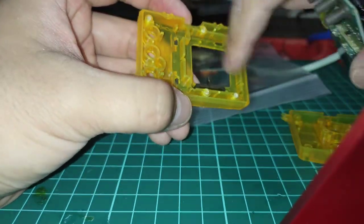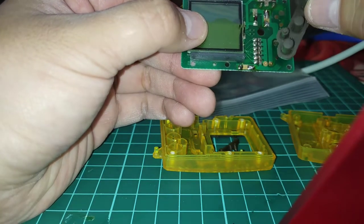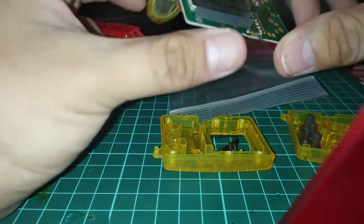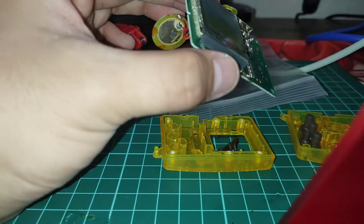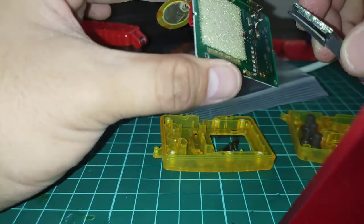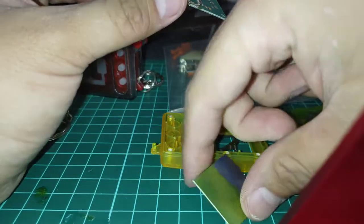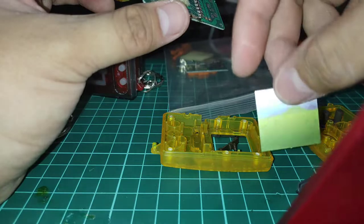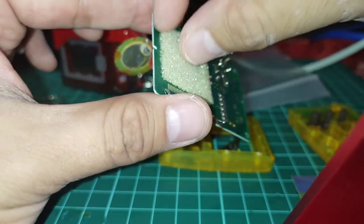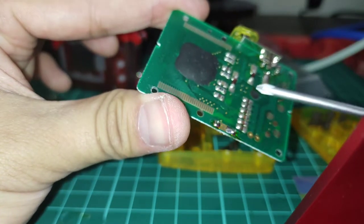There is a little piece right here that holds the screen to the frame. Due to years of age, the buttons may become stuck on here — thankfully they're not stuck on for me. The screen is usually press-fit into the board. Due to years of being stuck in there, it's going to feel like it's stuck, but really it's just friction holding it in place. The screen consists of a piece of foam, the background — which fell out right here — it's usually like a thick glossy cardstock. This piece of foam helps add pressure when the board is pressed against the screen. You get a blob of epoxy which is like the brains.